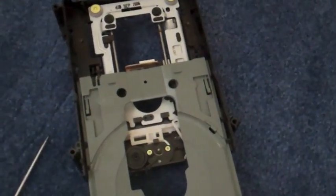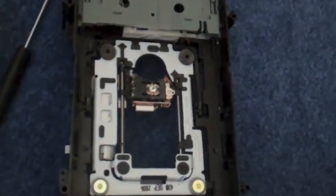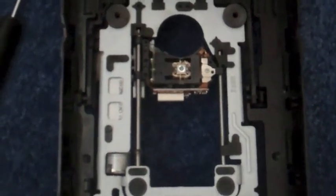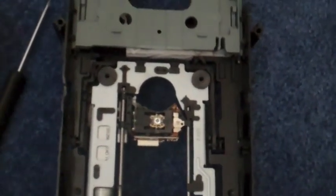Also, you should definitely clean the internal of your disk tray, the sides right here. If it's having opening and closing problems, you can try greasing up the rails right here with Vaseline or some kind of greaser. I've noticed that helps a lot too. But those are just some basic fix-it-yourself repairs you can do rather than having to pay 30 or 40 dollars. Those are basic repairs that won't damage your Xbox any further. Alright, well I hope you like this video — if you like it, please like and subscribe, and I'll have more videos coming soon.